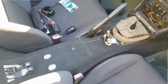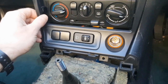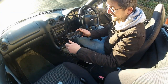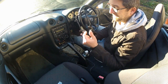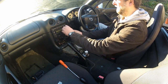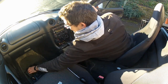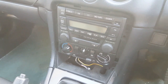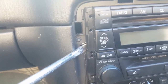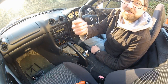With the center console out of the way, the next thing to remove is this piece of trim, held in place by four clips and two screws down here. I'd suggest undoing the two screws and then levering the trim outwards from the bottom — not the other way like I did and nearly broke one of the clips. Next, remove these two little pieces of trim down the side of the radio — they just pull off. Removing this trim around the radio lets you get a screwdriver behind the lip of the stereo for leverage.